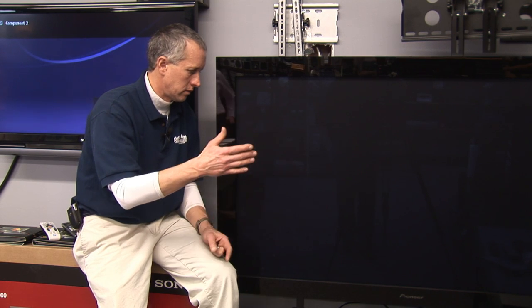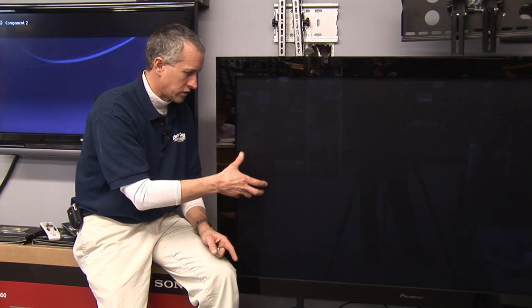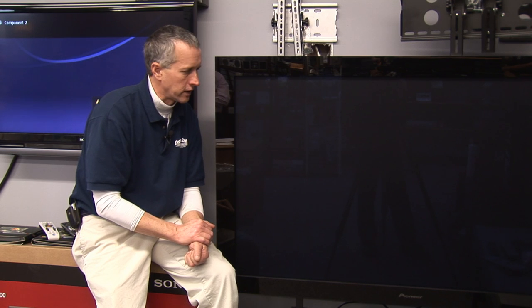Typically the distance of the signal being traveled from the picture tube guns in the back of the set is about two feet. Each one of the three guns has your three primary colors — red, green, blue — and those colors mixed together will produce the proper image on the front of the screen.